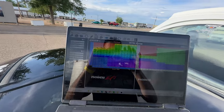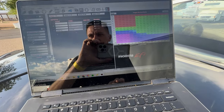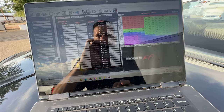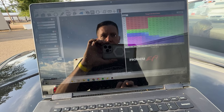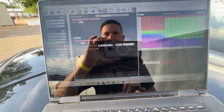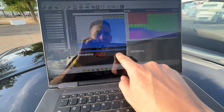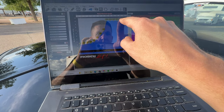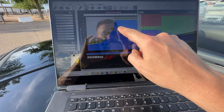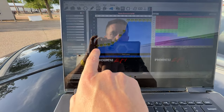So, came into the Holley, I went into my outputs, go to shift solenoid configure, set that to 7,000 RPM. And then in the boost curve, I went ahead and changed that up. Instead of coming all in by 4 to 5 seconds, now we're all in by 2 seconds. And then I taper it from 0 out to 2. We're at 0 on the gate.